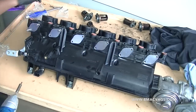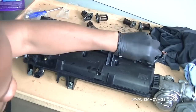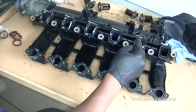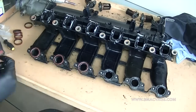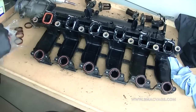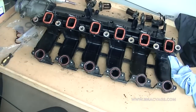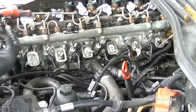You don't want those flaps falling inside your engine, so just replace them and get the job done. Along with the blank removal, I chose to do the gaskets at this time. What you see me wiping on is a bit of vaseline — I did it for two reasons: to make sure the rubbers stick and stay in, and to give it a nice seal. My gaskets were leaking a little bit and since everything was already out, I decided to replace them. Some of these blanking plug kits come with a whole gasket set, so it's a good thing to do while it's out.